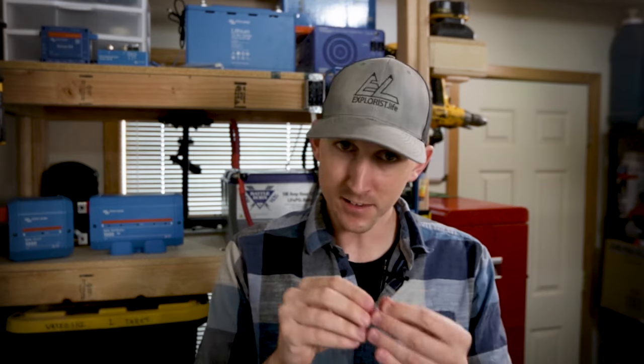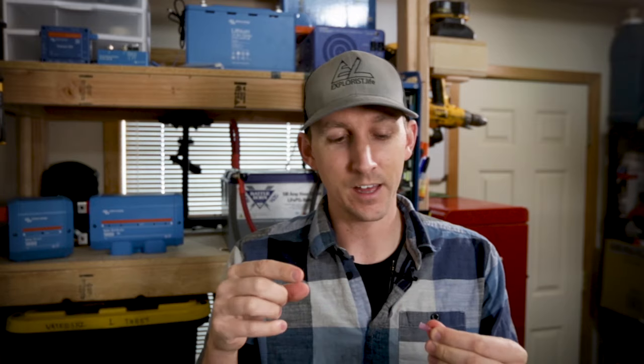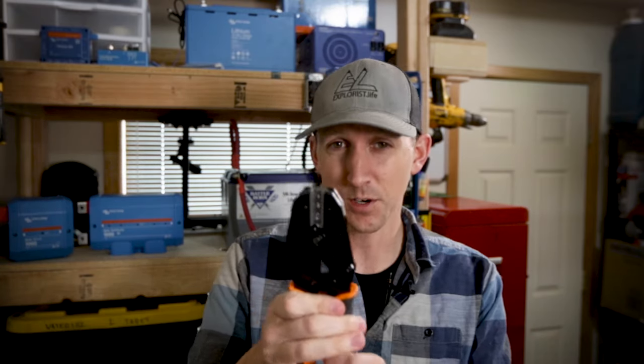Now let's talk about ring terminals for smaller wire. The ring terminals I like actually have heat shrink already attached to them. The ring terminals you can get from your local hardware store that have the nylon insulators instead of heat shrink ones just don't seem to hold as well, and you still need to put heat shrink over them anyway — getting heat shrink over those nylon insulators is just a hassle. This ratcheting wire crimper is my weapon of choice for crimping terminals in the 22 to 10 gauge range. These jaws are specifically made to crimp heat shrink terminals as they don't have a sharp spike that will damage the heat shrink like the crimper function on a wire stripper.